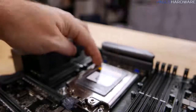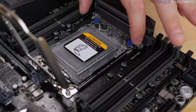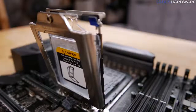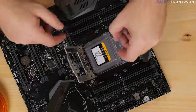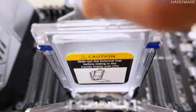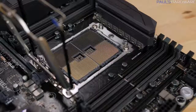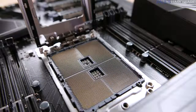When you get screw one unscrewed, you'll notice the lid will probably try to pop up by itself because it is somewhat spring-loaded. With the upper bracket raised, you'll see a lower bracket beneath and two little blue tabs towards the top of the socket. Just grab those from the side and lift, and the lower bracket will pop out of place — it has catches on either side. There's also a clear plastic piece at the center in place of where your CPU should be. Remove this by sliding it out of the carrier frame, noting the little rails on either side. Once removed, let the carrier frame pop up all the way; you'll then see a protective socket cover labeled Socket SP3. Grip that from either side, pull it up, and it will expose the pins underneath. Pins are very delicate, so be careful not to touch them or drop anything into them.